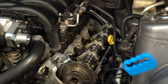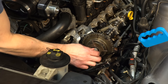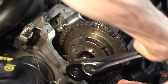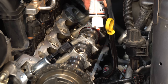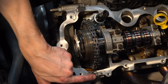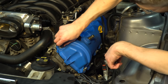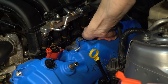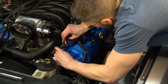Double check that all the roller followers are in place and torque the bearing cap bolts to 89 inch-pounds. Apply a bit of fresh motor oil to the phaser bolt and hand tighten. Torque the phaser bolt to 30 foot-pounds and then crank the bolt another 90 degrees. You can now remove the timing chain wedge. Apply lube to the camshaft lobes. Carefully remove the old RTV where the front cover meets the head and apply fresh RTV. Place the valve cover back on the head and torque the 8-millimeter valve cover bolts to 89 inch-pounds.